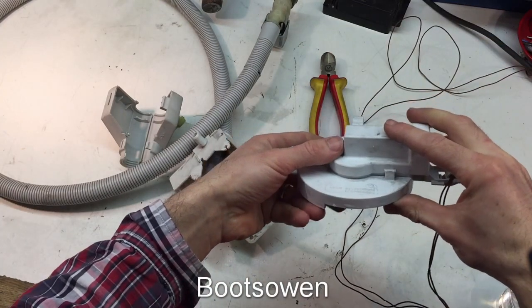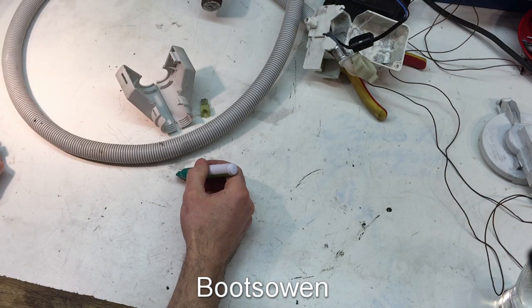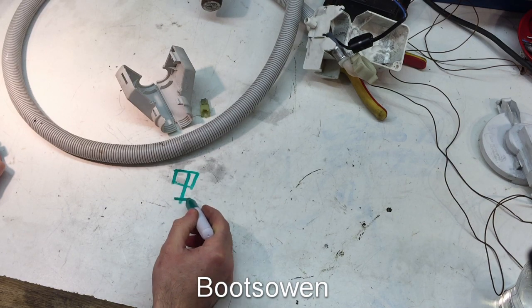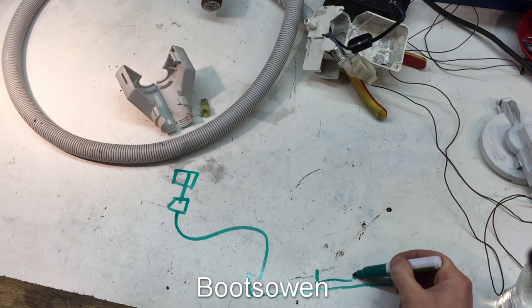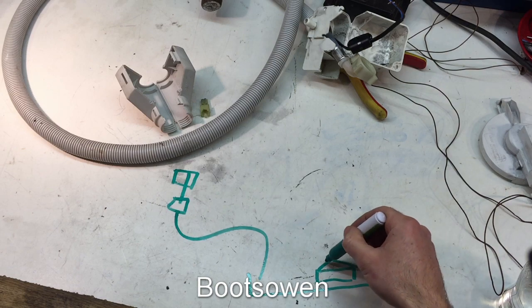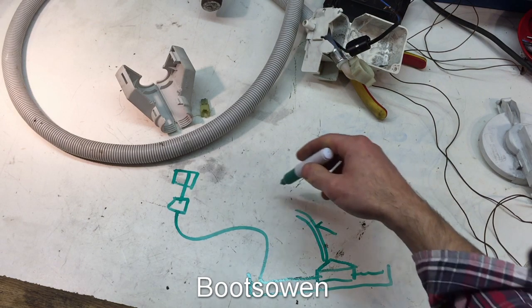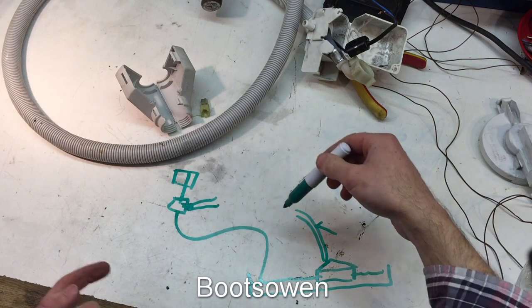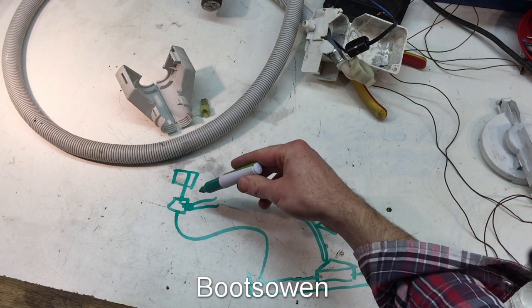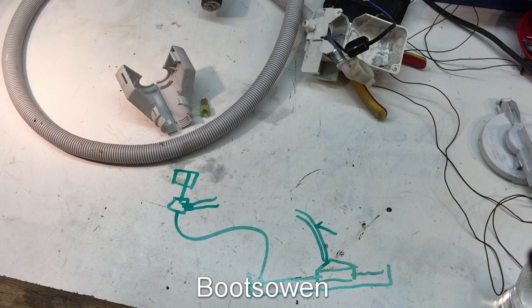So in the simplest possible terms: you've got your faucet on the wall, your solenoid switch, and your water coming into the machine. At the bottom of the machine you've got your AquaStop tray with your AquaStop float switch and cables coming out. If water comes in and rises the float, it breaks the connection, which stops power flowing to the solenoid valve, meaning no more water can come in. Kind of clever, kind of simple — water comes in, turns off the water at the switch. That's your Bosch AquaStop mechanism. Thanks for watching, see you next time.